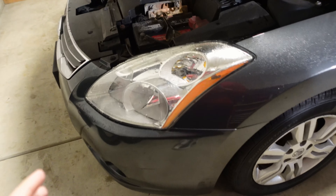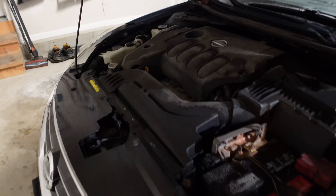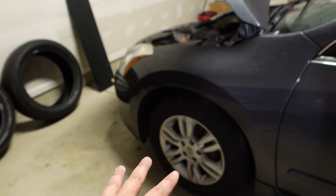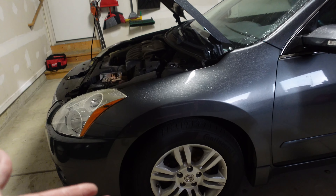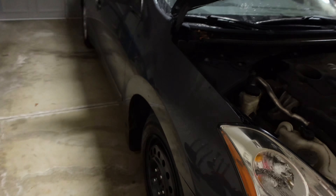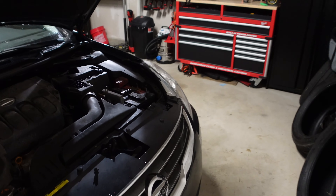Today we're going to be doing an upgrade on the lights, and I'll be showing how to replace them — even if you don't want to upgrade, just how to remove the bulbs. On the Altima, you can't get to the lights from the engine bay because there's too much stuff there, and there's a giant frame on the other side. So on this car you're going to have to go through the fender liner. You can leave it on the ground and turn the wheel all the way in, but in my situation I have a spare tire on the passenger side because the tire went flat, so I'm removing the wheel on both sides anyway — which makes the job a lot easier.